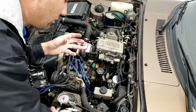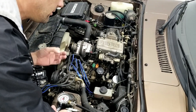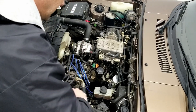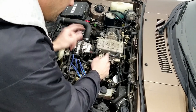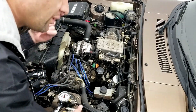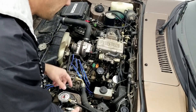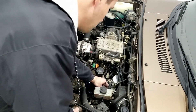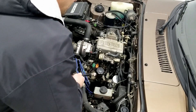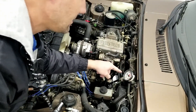Now that it's warm — I let it run until it was up to operating temperature and the RPMs came down to a normal warm-engine idle — I shut it back off. I pulled the bottom two leading spark plugs and the upper spark plug wires so it won't fire up, and I unhooked the two wires off the ignition coils — one of which powers the fuel pump — so it's not running and dumping fuel during the compression test. We've got the compression tester hooked up to the leading plug on the second rear rotor housing, and we'll cut to a different view so you can see the gauge.